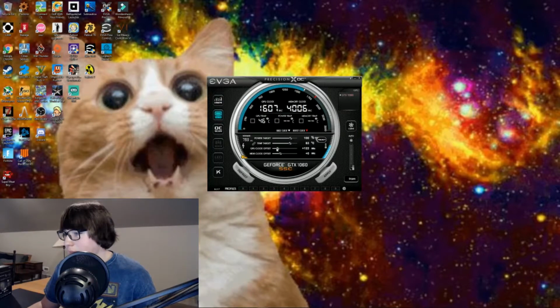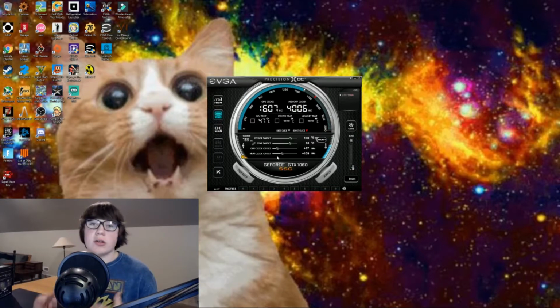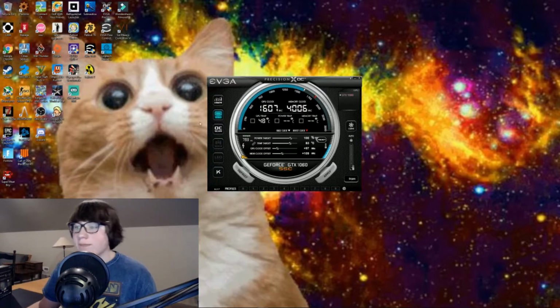I think it goes up by 13 every click. So what I managed to figure out is I think I can get like 97-ish with 109 for the memory clock offset, or opposite of that. I'll have to check my records, and that's why it's important to keep a record so you can remember this stuff, or keep a note on your computer somewhere, or even down here you can have different profiles. So use what's given to you, use the software.